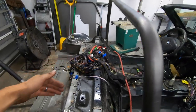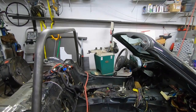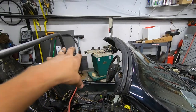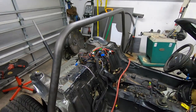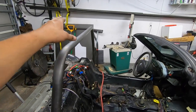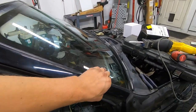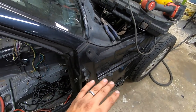First, before I get my rear down tubes set, I think I want to do my front A-pillar. I want to make sure this line looks proper — that it comes off the windscreen and is all level. Because I do want to do some sort of hard top that's removable with either a roof scoop or side scoops or something to cool either one radiator or two small radiators on either side. As of right now, it looks like it's sticking up high because the windshield is bowed, but if you put a level on the center from here to here, it's flush. I was planning on having the tube come down almost on the outside of it and then straight down through here. So I'm going to cut a little window and mount that.